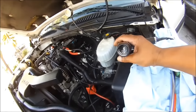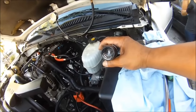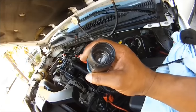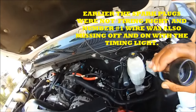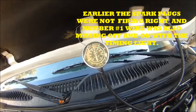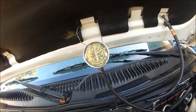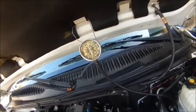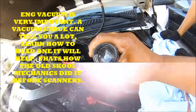Start it up. Look at that — much better! Sounds way smoother, the engine's smoother. Let's look at the vacuum now. Look at that vacuum — it doesn't say it's good, it says late ignition timing. We're stuck at 15 inches of mercury, and we need to be at 18 to 22. But our spark looks good here so far.